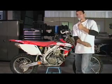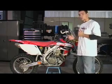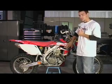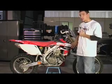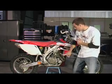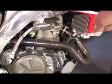Secondly, we wanted to clean up the way the bike ran. Part of the big problem holding this thing back was that it was a California legal model — it was meant to run in all states, and that meant it had a lot of emissions control, all centered right here. As you can see, we put in a Precision Concepts block-off kit. What that allowed us to do was bypass all of that emissions control, yank that stuff off of there, and save a little weight.